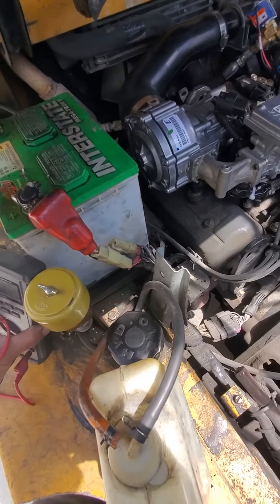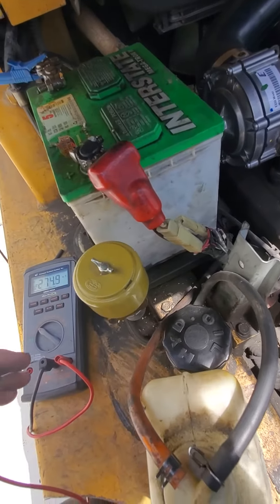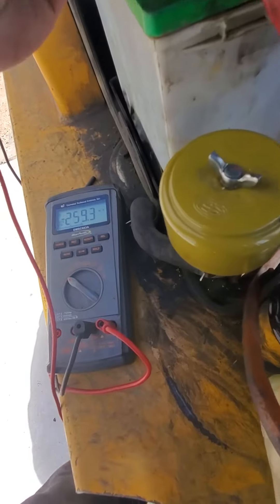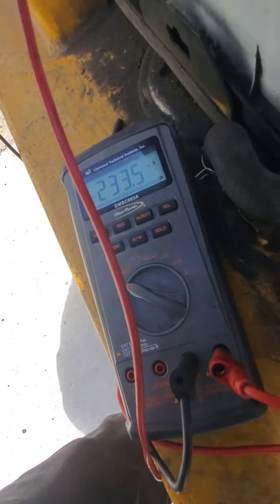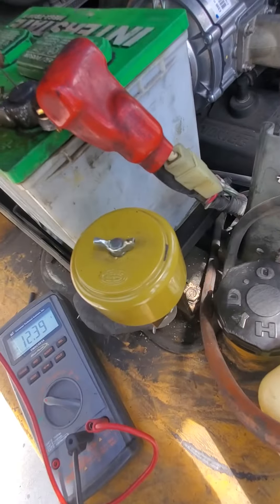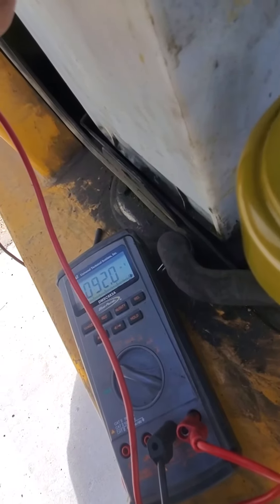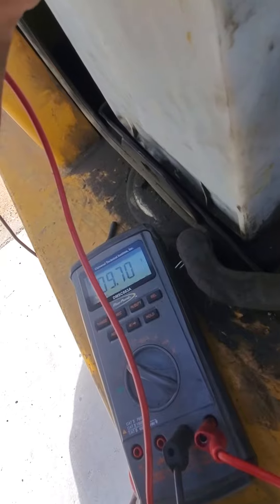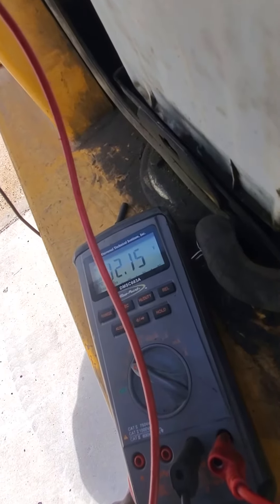This is just to confirm that this is a totally different issue. Going right to the battery — it's like there's no battery power. I'll check the battery: got 12.4 volts. Now at the cable, I have 12 volts.